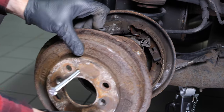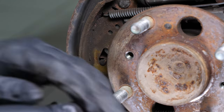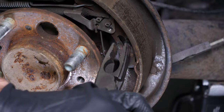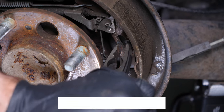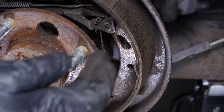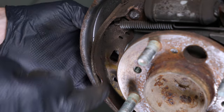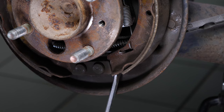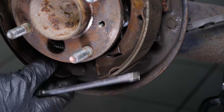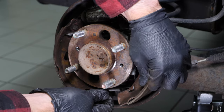You can now access the brake mechanism. Now you have to remove the mounting system of the shoes. Using pliers, unclip the clips holding the brake shoes, sliding them downwards. Then remove the rods. Using a flat-head screwdriver, pry the brake shoes out of the lower housings.